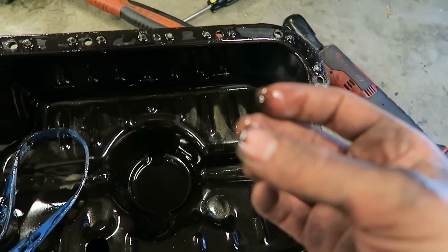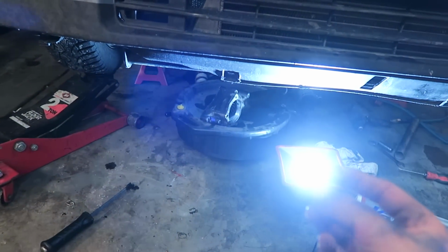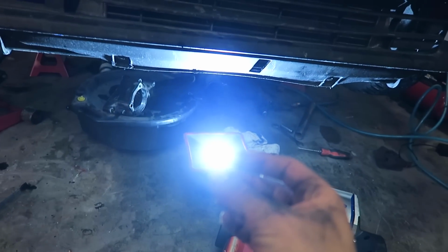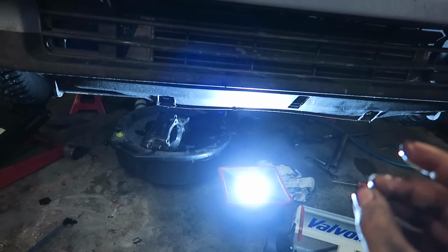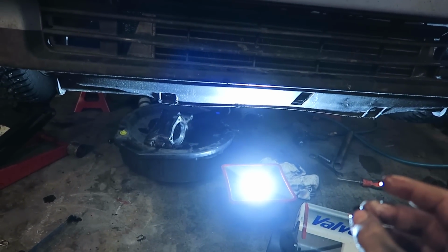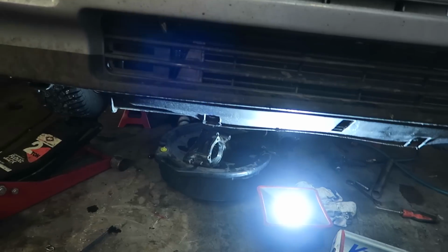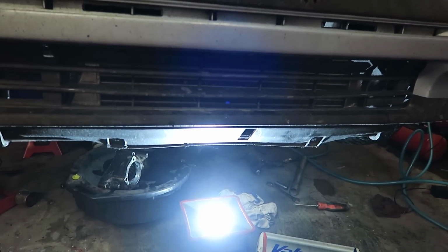And honestly, even if it's a little scored, I'm not sure. I should probably get a new crank no matter what, and rods, to do this correctly. But just for now, we do have that extra D16 and the bearings out of that thing were in pretty good shape. If I can get away with it just for now, just to get through winter, I might just slap in the bearings out of that, and hopefully it'll be okay like that. So we'll see, because I really need to pull that carriage off to know for sure.